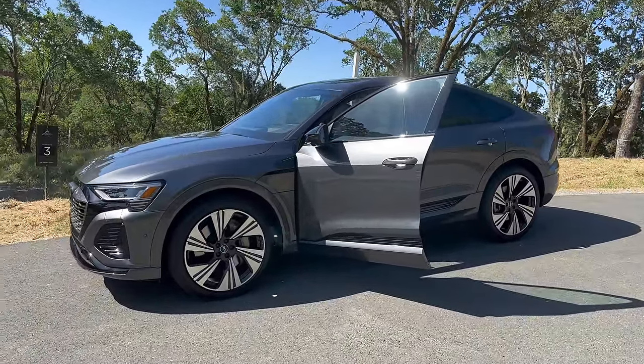Steering feel is improved. It's still an SUV and it's pretty soft and there's a lot of compliance, but, you know, 50% stiffer bushings up there in the front in terms of lower control arm and steering rack and all of these, that whole area is way stiffer and way more locked in. So loving all of that. The ratio, what I'm talking about, is so much tighter on the steering wheel. The rear of the car settled down. It doesn't seem to bounce as much on the back end. So I think all of the suspension and body enhancements certainly are nice.